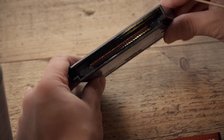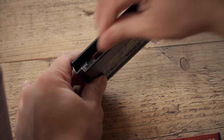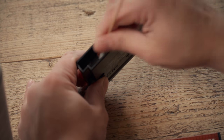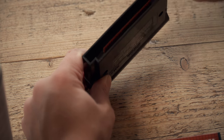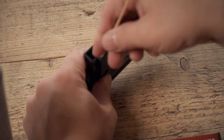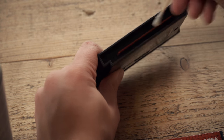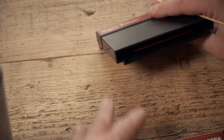I'm trying to get the light into that. There you go — that's a bit better. That's not too bad. You can get a bit of grey and muck on there. And then once you've done with the edge connector, just go around the inside as well and give it a wipe. What you do want to be careful of with isopropyl is it dissolves glue, so be careful not to let it too near the labels. That's not the worst I've seen by far, actually.